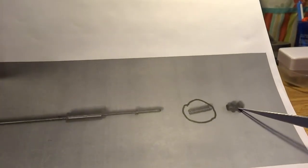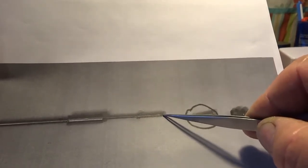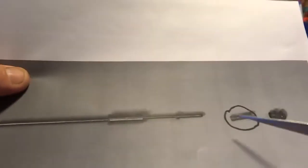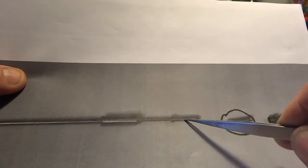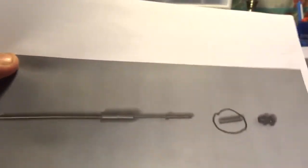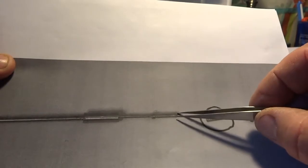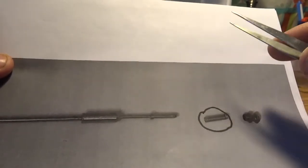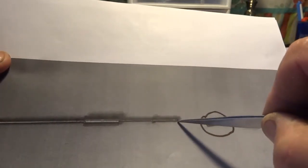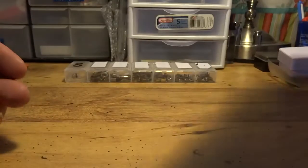Here it is with the bottom valve piece removed, showing the spring that fits over it. This is the stopper — a little black thing on the end that goes up and stops the hole from letting gas come through. When the valve is up, gas comes through a little hole and protrudes all the way up the side of these two valves, coming out in between them. These lighters aren't made to just be left on and on, because this valve area will get hot, and you're dealing with a stopper that's one millimeter wide and half a millimeter thick.